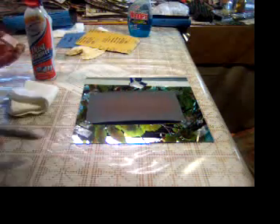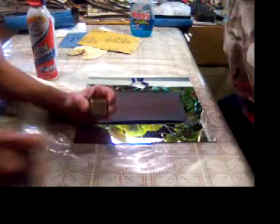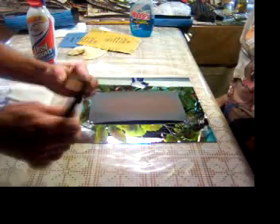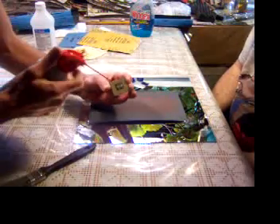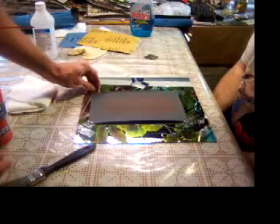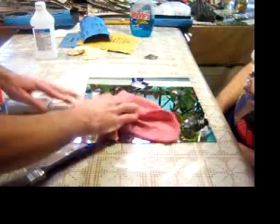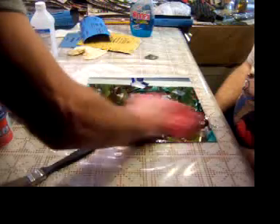This is part three. Unfortunately, due to technical reasons — okay, the CPU got a nice little polish on it. A little brush here, nice soft bristles. I like paint brushes for that reason. Clean off the back side, make sure it's all nice and clean. Blow it off. Take the CPU, lay it down — never on the pins or you will break things. Take a little rag, not a tear cloth, and wipe down the mirror. We don't want anything on the mirror that's rough.